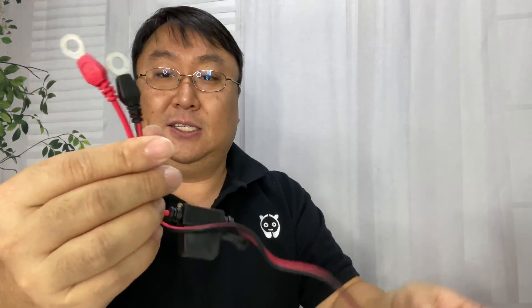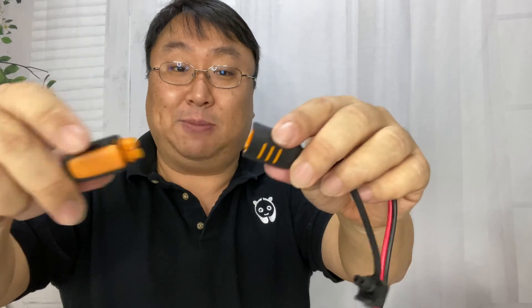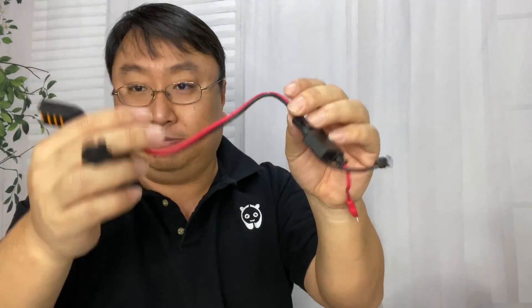The one I'm going to use — because on my Maserati it's made all the difference — is the permanent connectors. You can see the two little ring connectors there, and you would attach these to the tightening bolts on the clamps on your terminals. You put these under the washers, tighten it down, and this stays attached to your car permanently. Now you have the quick disconnect, so I can take my charger, clip it in, which is what I do. The charger always stays connected to the wall, and when I'm ready to roll, I disconnect it and close up the trunk. That's where it is, and it's actually really nice when the battery's in the trunk — you just have this little pigtail hanging out. Under the hood you do get this little rubber cap so you can plug it up to make sure it doesn't get messed up if exposed to grime, dirt, or water.